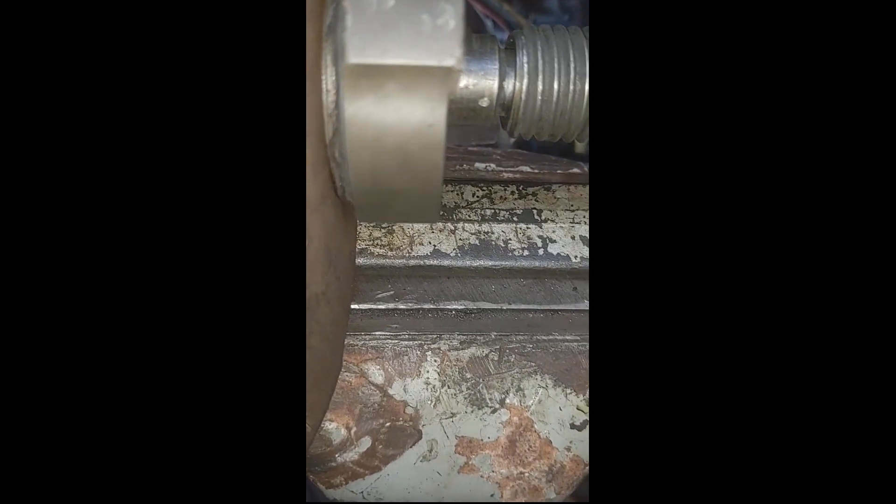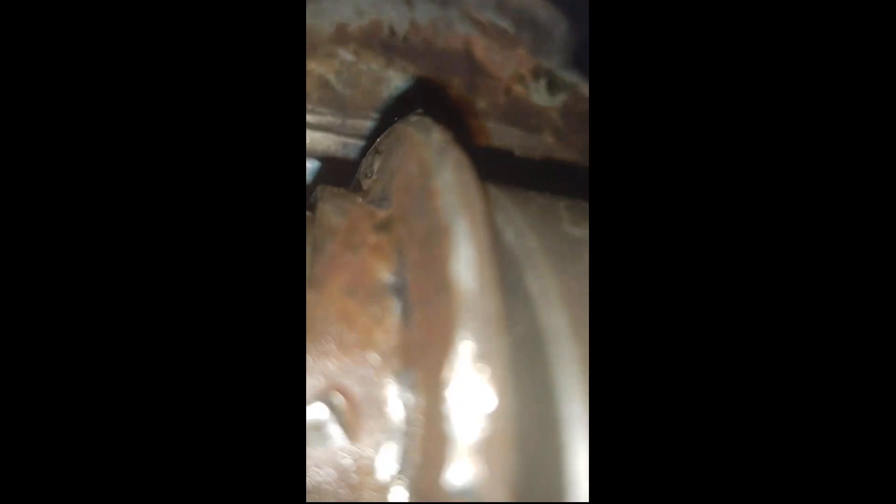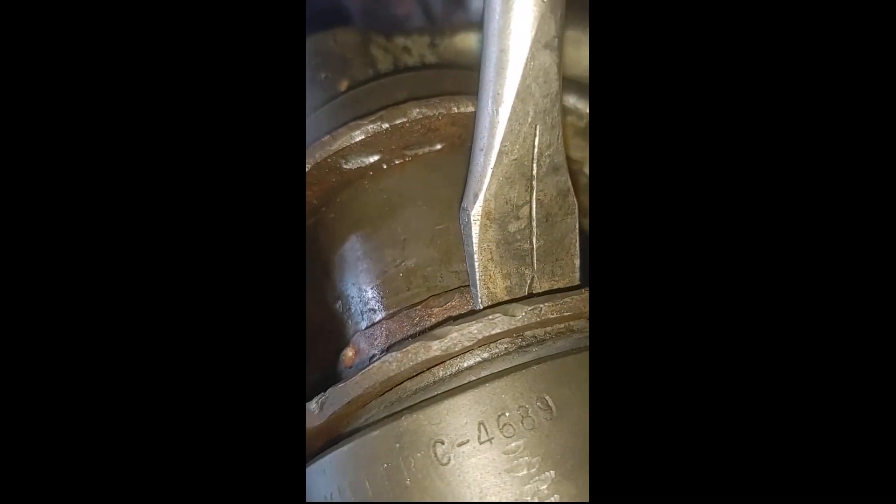I got it! See - my eyes were just playing with me but it was just a tiny bit on one side. That was the only way to do it. I loaded it up because it didn't really want to go. The G-Bodies don't have it this thick - I don't think. I did a '78, and this is only an '82, so you'd think the quality would have gotten worse, but apparently the bushing material is actually thicker.